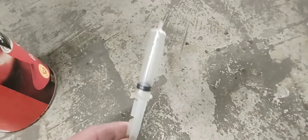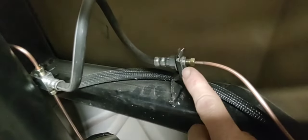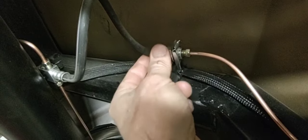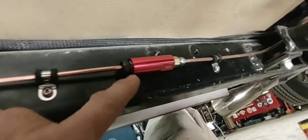I got that brake master cylinder all drained. I used a windshield chip repair kit — those little syringes are killer for this kind of stuff. I got one of the old brake lines out — the rear one — and I already got the rear one made. The rubber brake line is twisted so it's not gonna rub the floor pan no more. I put a special clip that holds the brake line on there — it just had a zip tie before. Got it running along the frame, not touching the frame. Got a nice clamp there, a nice clamp there, the residual valve and a clamp holding it away from the frame, then it goes up and around the cross member into the master cylinder.